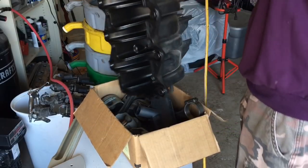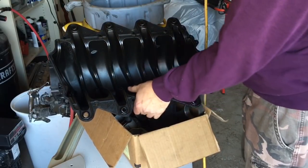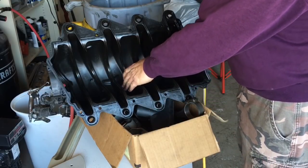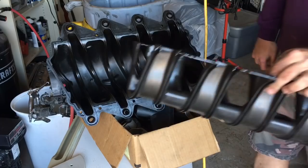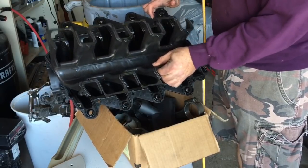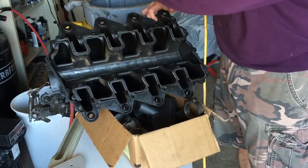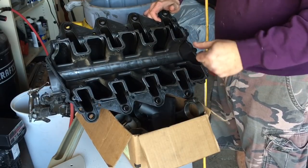But with these things, it's a three-piece intake. You've got your upper plenum — basically your upper or ceiling of your runners — then you have the floor of your runners that's set in there, and creates the actual runners to your port from the common plenum, if that makes any sense. So you basically got the floor of your runner, the roof of your runner, and then I've got the lower intake over here in the vice, I'm going to show you in just a second, because that's the one I started working on.